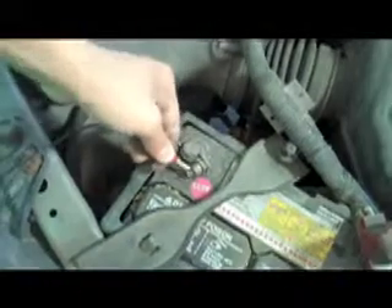Put the alligator head on the negative — make sure it's on the negative — and with the tester, hit on each side. This side glows, that means it's good. This one glows too, so the fuse is good.